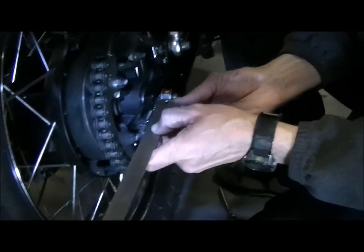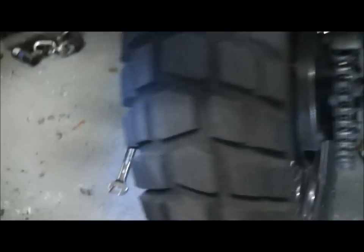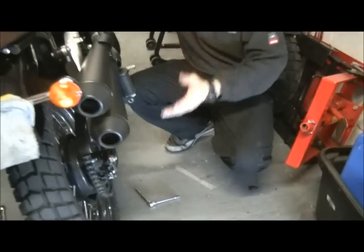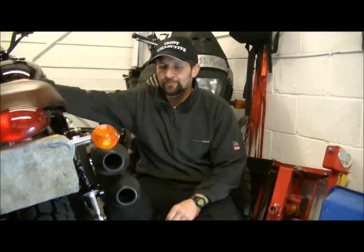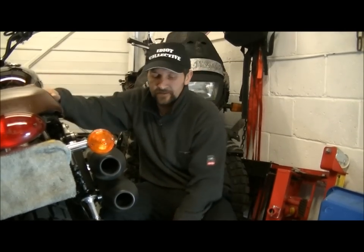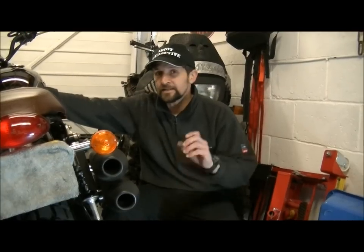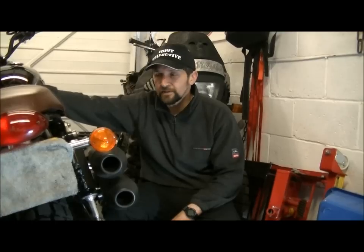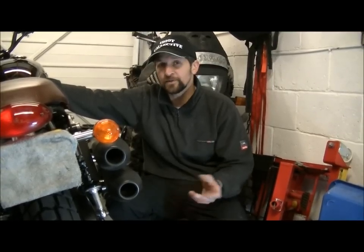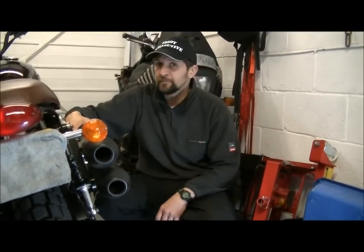Final check of the actual alignment itself. It's gone up to 29 - so half a mil difference from just now. Check the other side - yep, 29 as well. Perfect. So the rear wheel alignment's bang on and the chain tension's correct. And that's Nirvana - that's exactly how you want it. Nice and safe. Wheel done up correctly. The torque on that is very, very crucial. Do make sure you torque it to at least 60 foot pounds, maybe a little bit more. But the marker paint does prevent you worrying - it's that belt and braces, that safety net. You can just do a quick visual glance of it and you know it hasn't undone itself. And don't go doing them up to 100 foot pounds - it really isn't a safe thing to do. They're not designed to take it. It will crush the bearings and do all sorts of damage. And it won't stop it coming undone - if it's going to come undone, it will be due to something else. I hope that helps. If you've got any questions, drop them in the comments box and we'll see if we can help. That's chain adjustment on a Scrambler. Ride safe. See you next time. Bye.